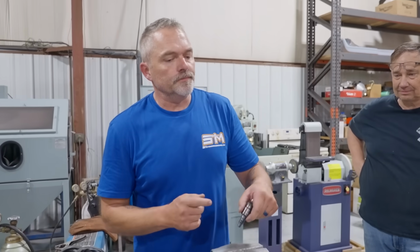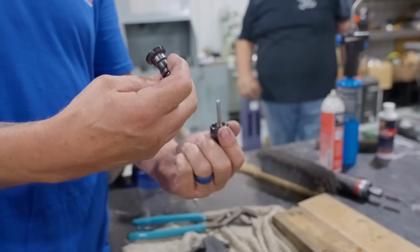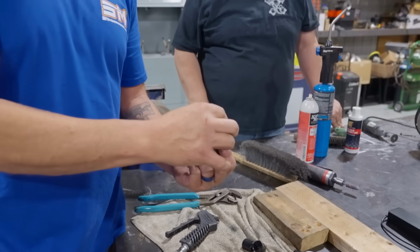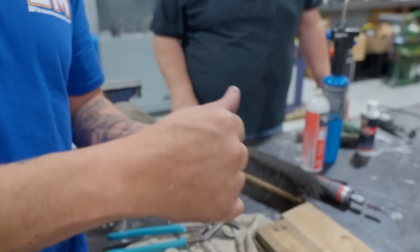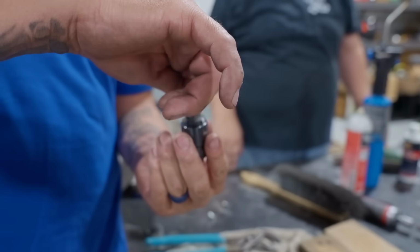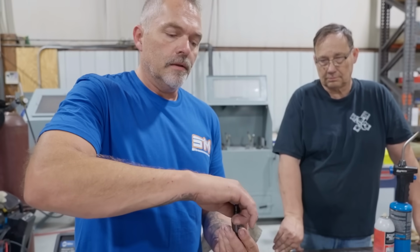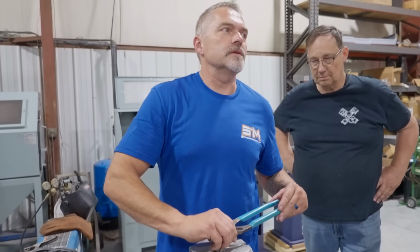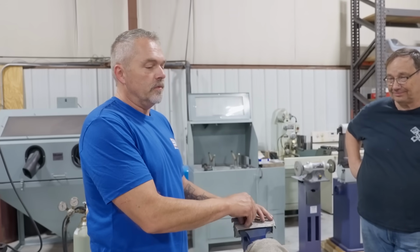We're taking this injector apart. I'll show you this. Non-billet atomizer, or even on, well, it's not stuck shut. Billet atomizer, a Fuel Tech injector. This is basically where they are. The bottom half unscrews from the top. But that is not rusty or bad. A lot of times, if you leave methanol in these too long, methanol absorbs water out of the air and it makes these things corrode and they literally rust shut. That is not rusted shut. Don't get hung up on me doing this with an improper tool, because there actually is no tool to do that. Not yet. Maybe we'll make one.